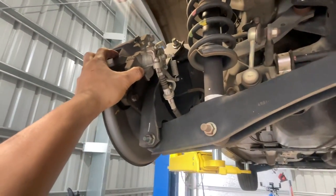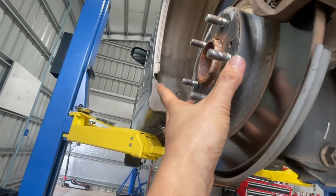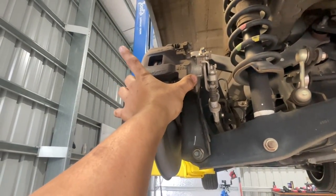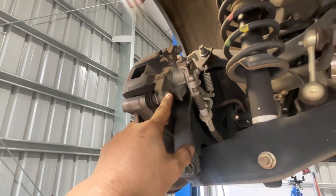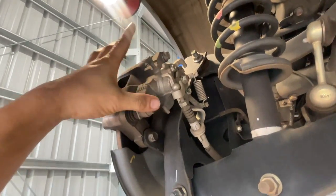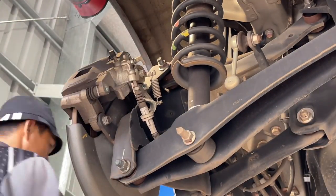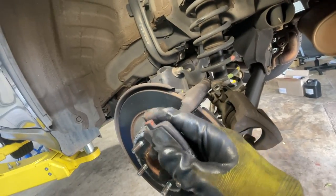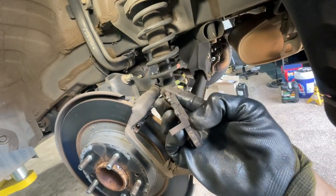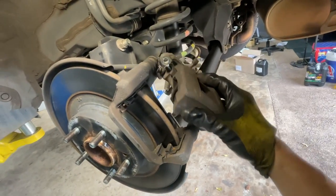It's common now in modern cars. Because it's all in one, you only replace the brake pads - the handbrake shoe inside the drum - you can save money. Now we will try to open this by removing the two caliper bolts - 14 mil - and this will pop up. Okay, our brake pad is quite thin already - about 30 percent left - nearly hitting the indicator there.